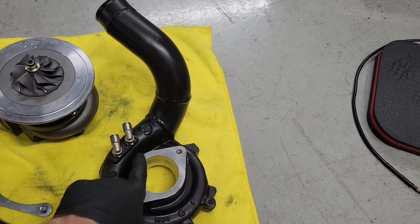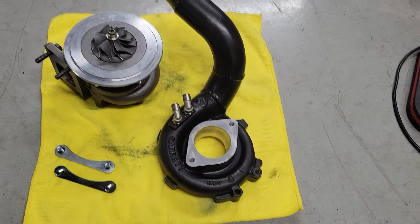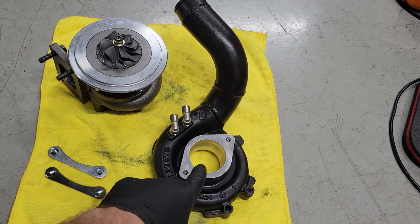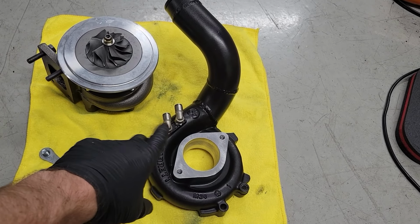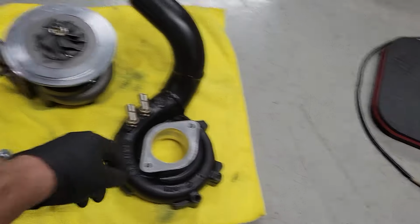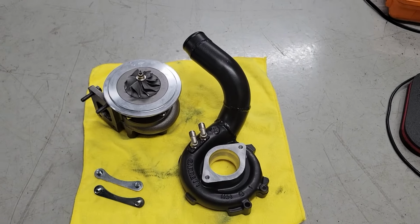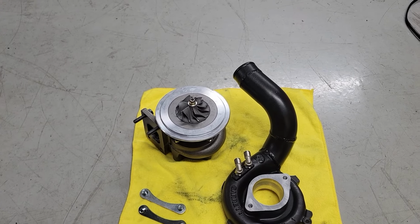Daryl also went through and got all the gunk that got built up on that inlet housing. Golly, I keep losing my words today. But he got everything cleaned up on the flange surface. And then we also put in these push lock lines, these quick disconnect fittings basically. So instead of having the barb and then zip tying it with a regular vacuum line, we're gonna run all push lock line through here. So it'll just be a much cleaner look. That's what the customer was going for. So we're just gonna clean this thing up and make it look awesome for them.